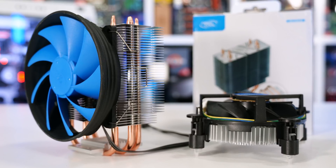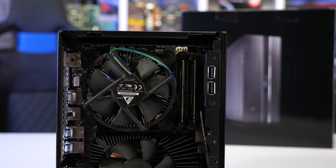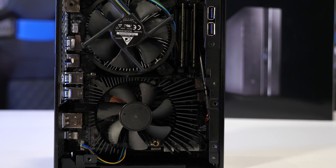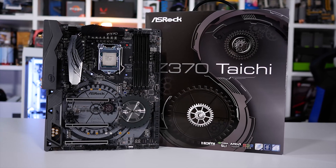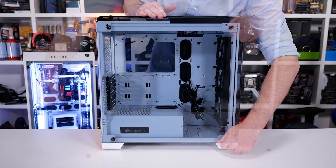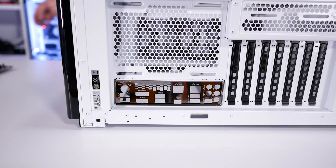In short, all this drama over TDP ratings and motherboard power delivery has probably been for nothing. The real issue is the underwhelming Intel box cooler, at least on the 8700, and nothing's going to change that for the upcoming B360 motherboards. As a side note, this was a best-case scenario for the Intel box cooler as it was fed plenty of cool air in a room with an ambient temperature of just 21 degrees, so you'll likely see worse results with the 8700 in a warmer environment. That said, I strongly believe budget parts like the Core i3-8100 and Core i5-8400 are going to deliver the exact same performance with the box cooler on B360 boards as they do on expensive Z370 motherboards, and I'm 99.9% certain this will also be true for the 8700, at least within reason. There will be some $50–$60 boards that might not be up to the task, especially those without any VRM cooling at all.